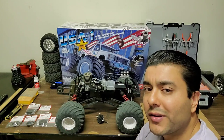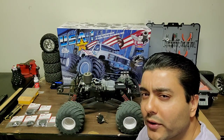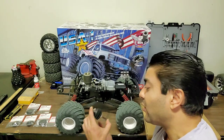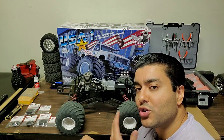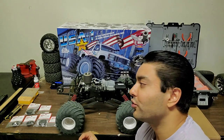Per page 37 in the manual and a couple of videos online — shout out to Anthony Grompton from Australia, he's got a video on how to adjust the clutch. The clutches in here basically adjust your shift timing from one-to-two and two-to-three. So I started tweaking with those.